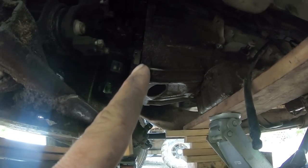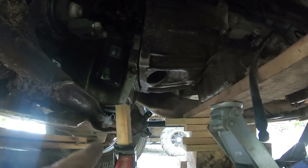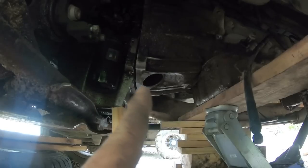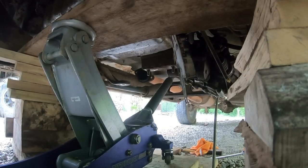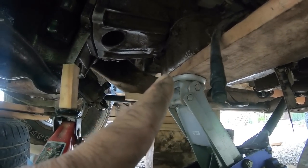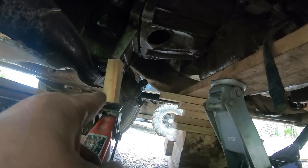What I found was the gap at the top and bottom were way different. I went back to the video when I took it out and noticed how much the back of the engine dropped when I pulled the transmission out. I figured I needed to lift the back of the engine up a little bit, did that, did some wiggling, and it went right in. This is also a reminder to take the transfer case off when you do this - I didn't, and since the transfer case is sitting back on that torsion bar, the back of the transmission was sitting up higher, which is why these weren't mating up correctly.